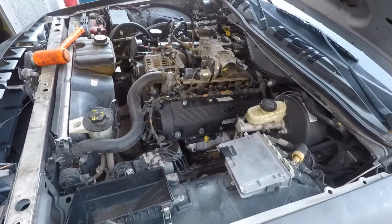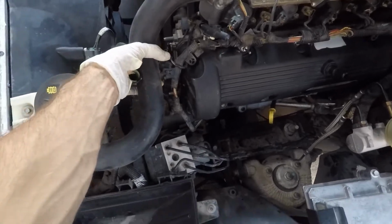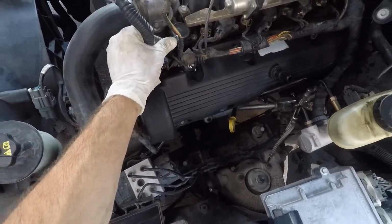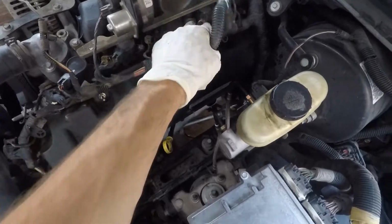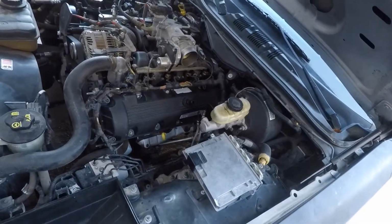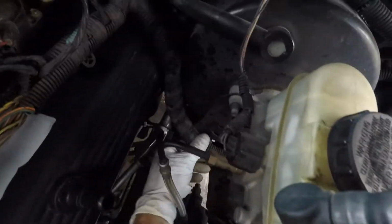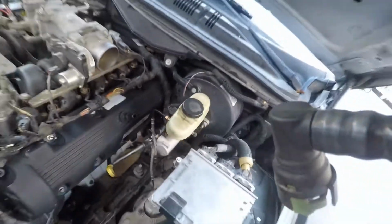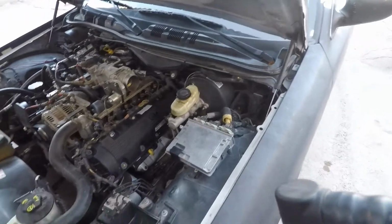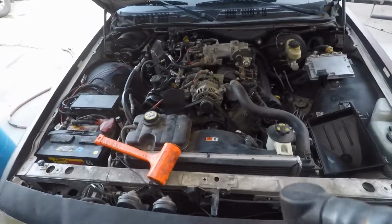on all 4 spots, so it's going to seal there. Put all your little holders back on, make sure everything's plugged back in. A lot of times these Fords have bad clips right here, and it's a super common problem. But once you get all that done, it's gonna be right here. And I told you guys to bend this thing, so just bend it back so it kind of sits right there real nicely. Yeah, and let's get this intake thrown on, and that's pretty much about it.